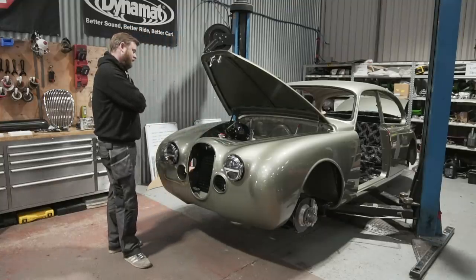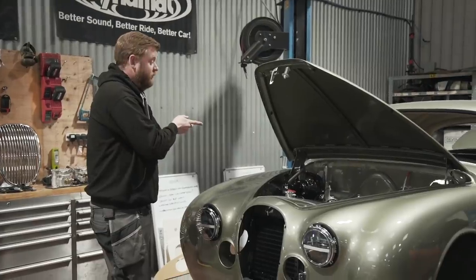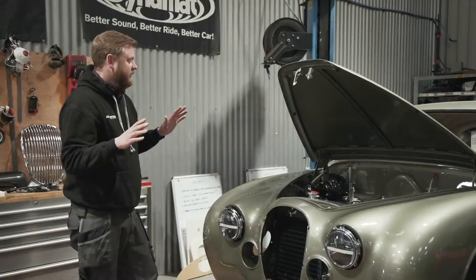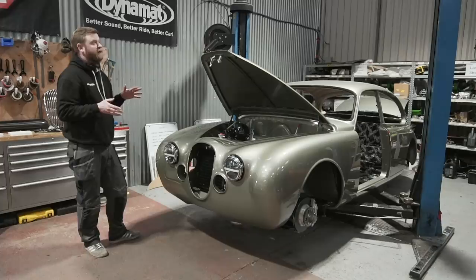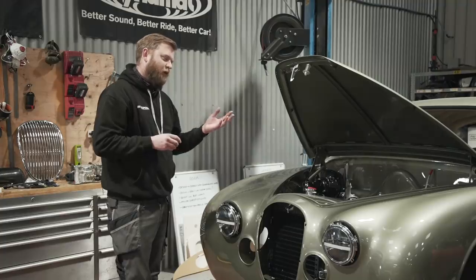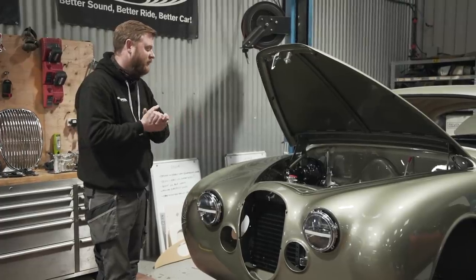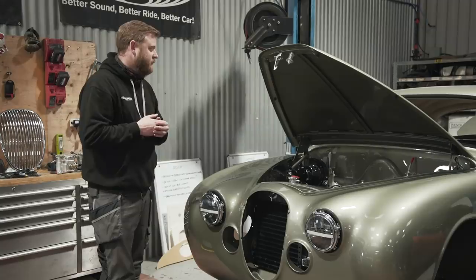The gearbox is obviously in situ as well - that's a BMW M3 six-speed manual box. We used an off-the-shelf adapter plate but had a flywheel made by TTV. I was quite specific in wanting a completely road-orientated clutch, so it's actually an original equipment BMW clutch for a non-dual mass model - an E28 M5 spec clutch, which will be a similar sort of power to this engine. It's always nice to call on the hours of development original manufacturers put into these things, so we can pretty much guarantee the feel of the clutch will be very much as per an original equipment car. So it's an E28 M5 clutch onto a bespoke flywheel, mating the Toyota engine to the BMW M3 gearbox.